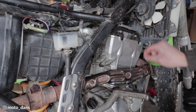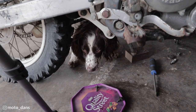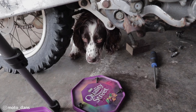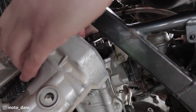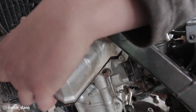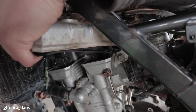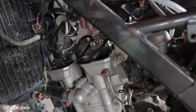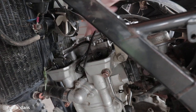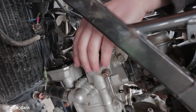One way to do the rocker cover is just put a bit of sealer in these end pieces here. My apprentice is just keeping an eye on me - she's going to steal that bolt there, I bet. Nope, she didn't. Good girl. We've got to feed the rocker cover in, just trying to keep that gasket in place. I'm going to set the gasket down on the block first. You could also glue it to the rocker cover if you wanted to.